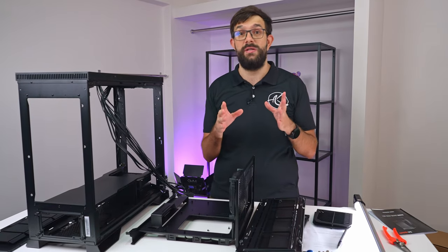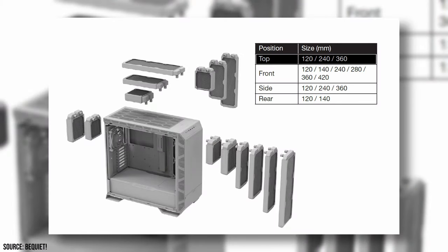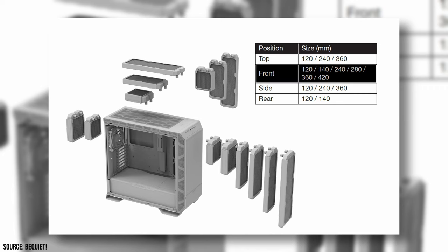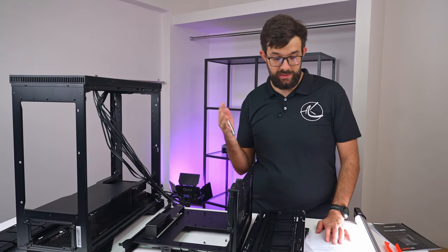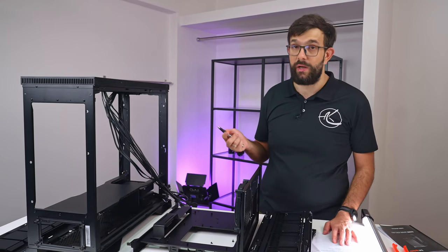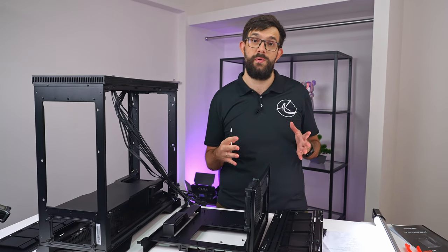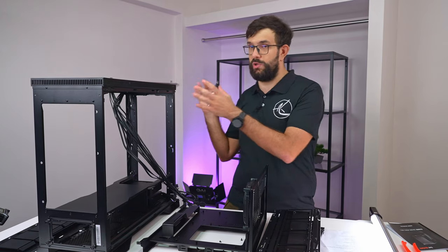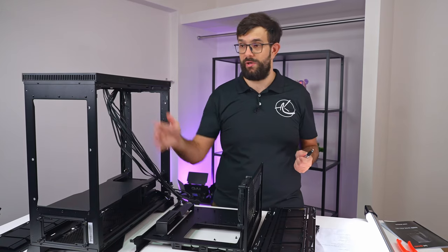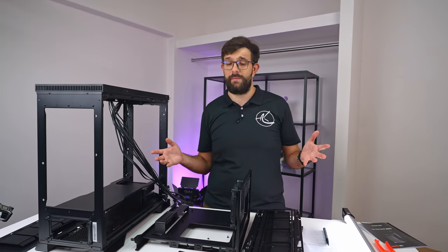The radiator support is as follows: for the top, 120mm, 140mm, or 360mm; for the front, 120mm, 140mm, 240mm, 280mm, 360mm, or 420mm - so you can actually have a triple 140mm fan radiator which is huge; on the side you can do 120mm, 240mm, or 360mm; and at the rear 120mm and 140mm. With a case of this size I would probably expect somebody to have a full water cooling loop - probably a 420mm at the front and a 360mm at the top. Then you could add extra fans on the side for additional air pressure unless you want to install a bunch of drives.